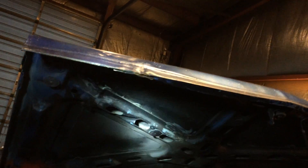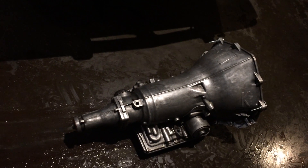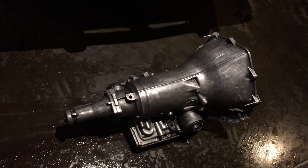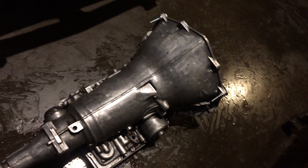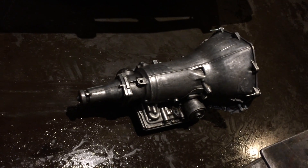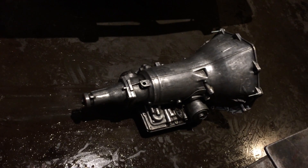The reason for that is, it did come into contact with a deer a few years ago. I rebuilt this tranny and it lasted, but it made a weird sound. Then it went out after a few years — I rebuilt it again. Unfortunately, by then it was in even worse condition. What I noticed when I took it out the second time is it may not have been in a perfect straight line with the differential. So we're going to make sure of that with the new one.